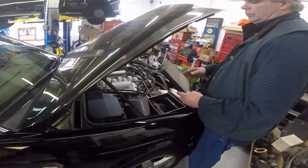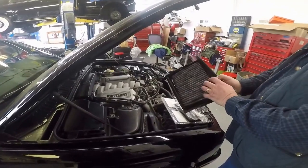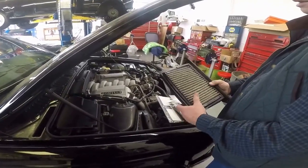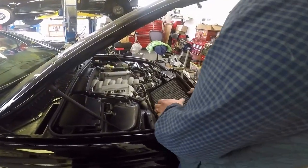Getting back to this filter — once again, this has a little trough in it all the way around, and the filter goes in that way. It will not go in the other way and sit down flat. So you can't get the air direction wrong.